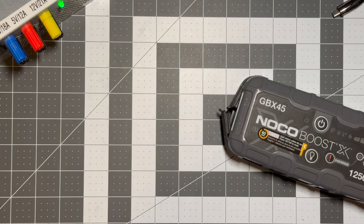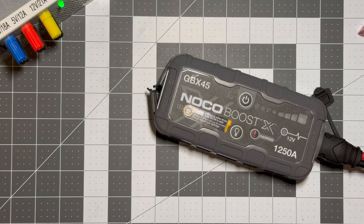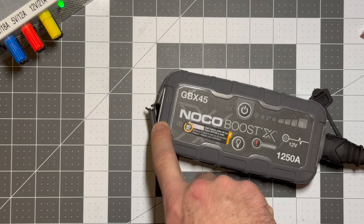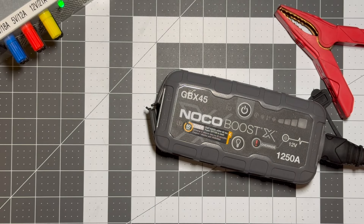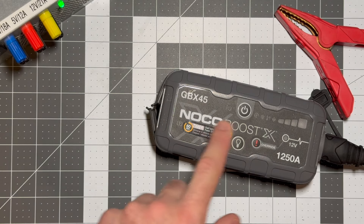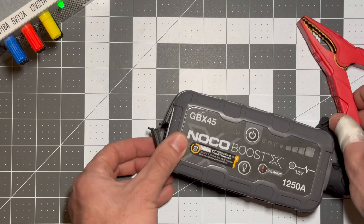So now let me show you some ways that you can more easily feed power into this battery. In the past I've had to open it up, but a viewer on a previous video alerted me to a really cool trick that utilizes the ground off of the USB-C port along with the positive clamp to get direct access to the battery inside. It works because the USB port is connected directly onto the battery negative and it bypasses the relays inside that turn on the high power, high current mode for actually boosting a battery.